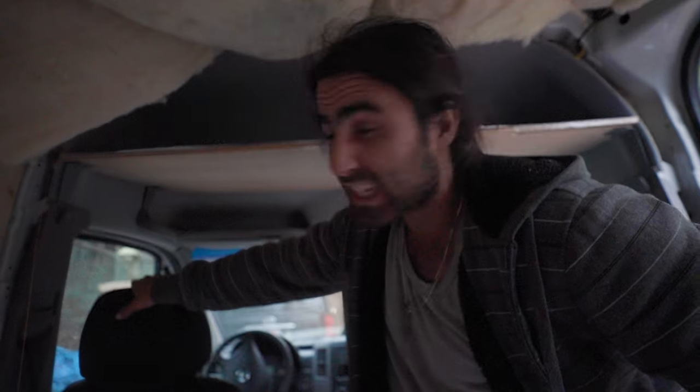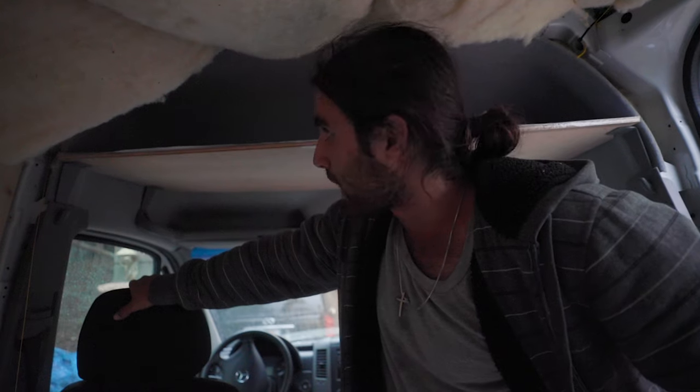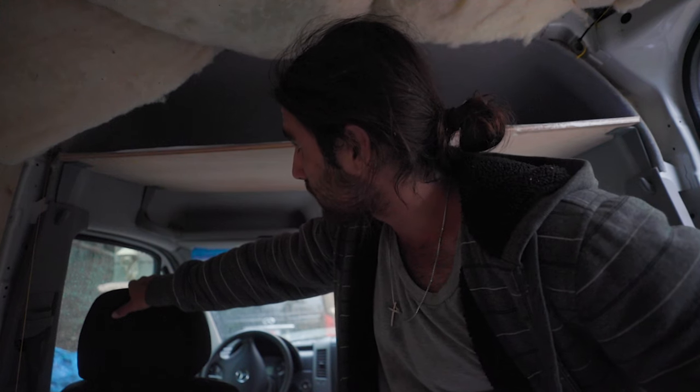It's a pretty snug fit, which I guess is good. I might trim just a little bit — like an eighth inch — off because if I wrap it with fabric, it's going to take up even a little more space. So I think just to be safe I might need to trim this ever so slightly. I realize it's about impossible to trim an eighth inch off with a jigsaw when you're on the edge like that, because the saw will just want to jump off the board. So instead I'm just going to do a really handy sanding job.